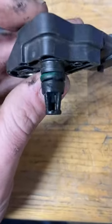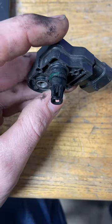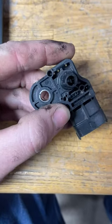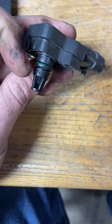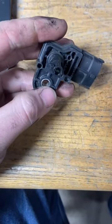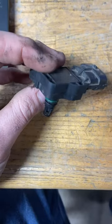So you can see here, this one actually had 90,000 miles on it and it just was deleted. As you can see, the middle rod is what reads the MAP sensor, and here's the crud on it. So all you need to do is just clean this crud off and put the sensor back in, and it'll help it from reading crappy boost levels and misrepresenting the fuel.